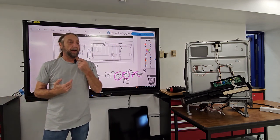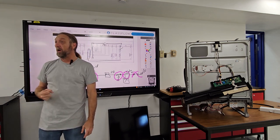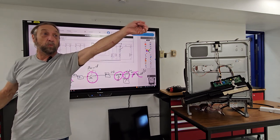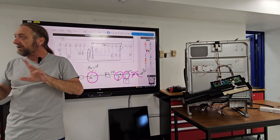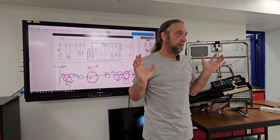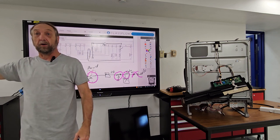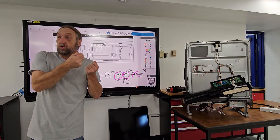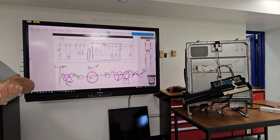The point is you need to know how much voltage goes to a part because when you're troubleshooting, you need to know if you're getting voltage to that part. What's going to make this water valve work is if I have 120 volts right to it. So we have to know how much power is going to whatever part we're testing.